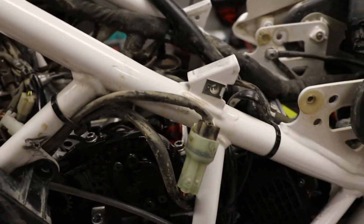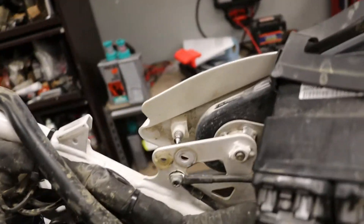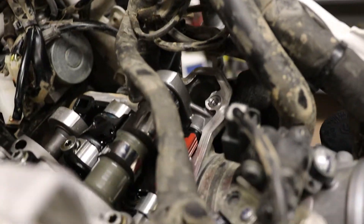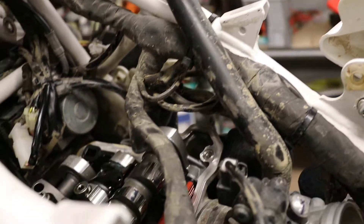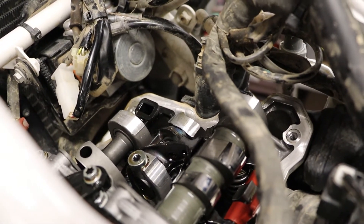There's just a bunch of little bolts you have to take off. There's two up front here that attach to the airbox and two back here. Then you can loosen up your air boot and just kind of shift it back and up a little bit and get it out of the way. You've got four or five big thick hoses you've got to tie up out of the way. Then squeezing the head cover up out of there is fun as well.